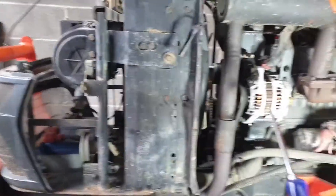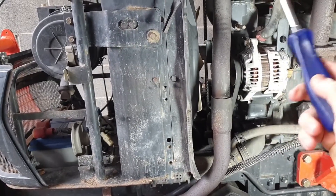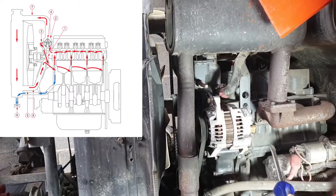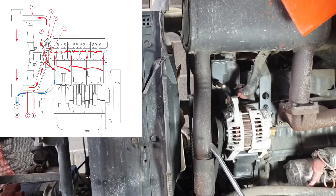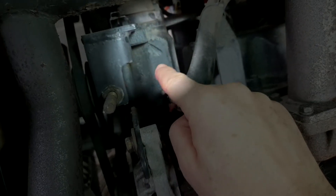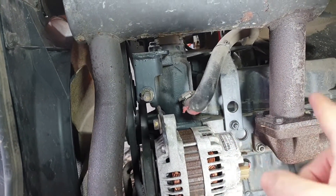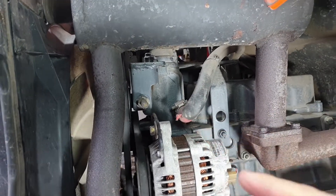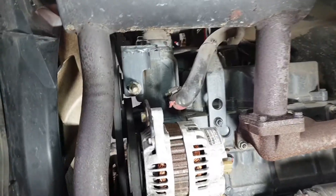A quick overview of a cooling system: you've got two circuits. There's a short circuit, and then a thermostat which shuts off the big circuit. The big circuit goes through the radiator. The short circuit helps the engine warm up quicker, gets it up to operating temperature. The thermostat then opens and controls the flow of coolant through the large circuit. The fan acts on that and maintains engine temperature. I suspect the thermostat isn't opening, which is why turning the heater on helps — it adds a second circuit, like a fan, with the heater matrix keeping it cool.